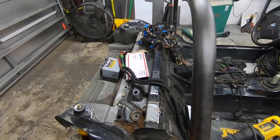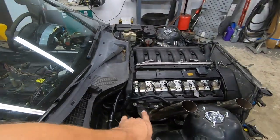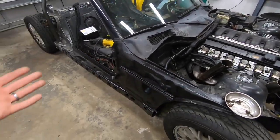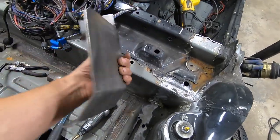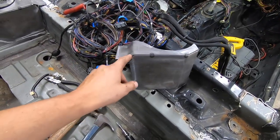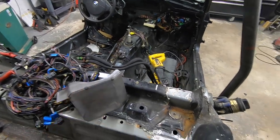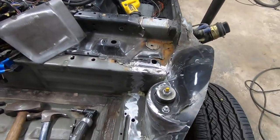It's just going to be awesome to have that opportunity. We'll probably reinforce the harness bar with some one-inch or inch-and-a-quarter, and I want to come through the dash here to the strut towers with maybe some inch-and-a-quarter too. It's all going to be DOM. We are at the point now where we are ready to weld these on. On this cage, I'm going to do a lot of TIG welding — TIG weld all these joints, all the cage joints, just for a nice, clean look. It doesn't have to be that way; MIG welding will work just as fine. But I will MIG weld it to the body just because the body is dirty, and it will definitely be an issue if you try TIG welding that.